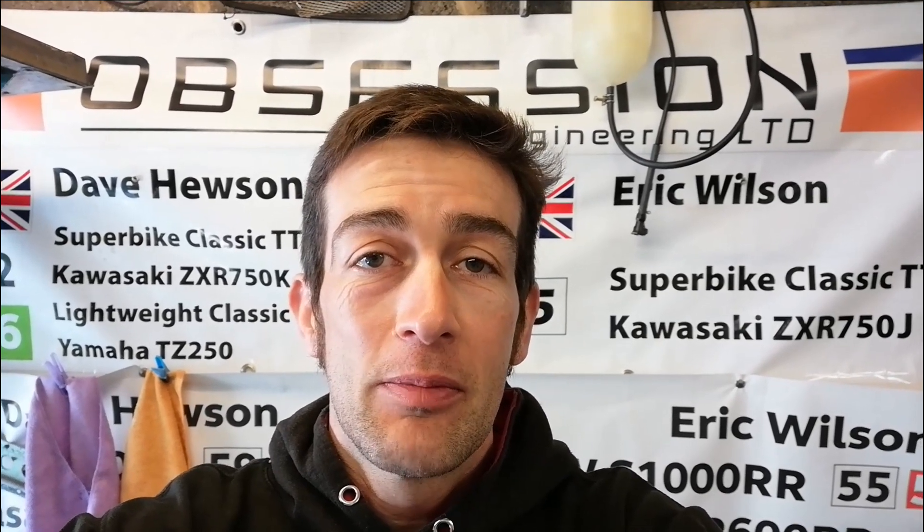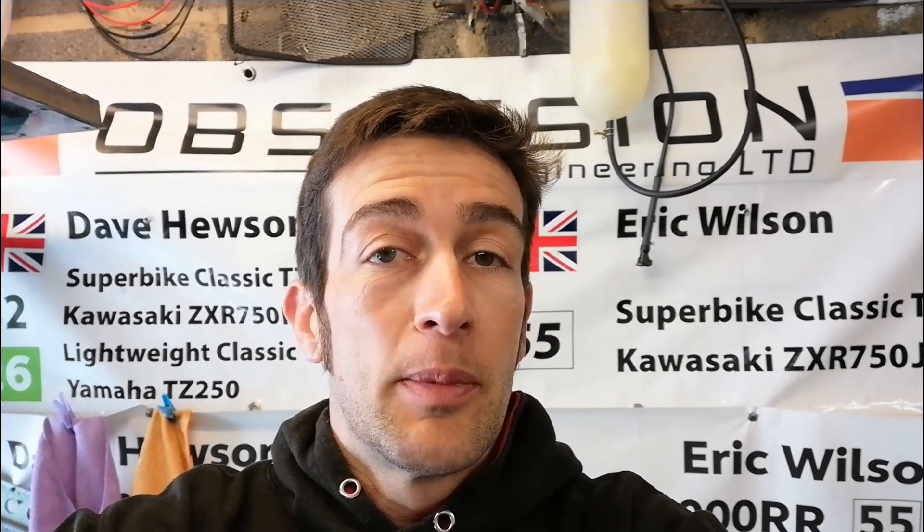Hello and welcome to the Obsession Engineering Control Bunker, where the magic happens. Today I'm going to be removing the brakes from my S1000RR race bike and servicing the calipers. The last couple of times I've ridden the bike I've noticed that there's a little bit too much lever travel for my liking, and I believe this is to do with piston pullback caused by the caliper seals either being a bit worn or potentially having a little bit of dirt or corrosion underneath them.